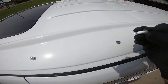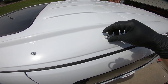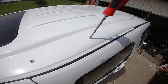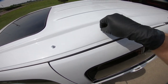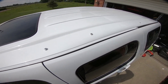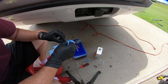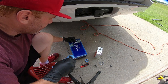As you can see I already ran one down. Once you get the Teflon tape on it, all you do is screw it into place. Make sure you have the plastic collar on before you put the Teflon tape on — it will probably slide over once it's in place, but better safe than sorry. Just run these down until they stop — we have to do this 10 times. I'm not going to use my impact for this because I want to make sure we don't strip anything out. Once it's in place, all we need to do is grab our newly painted cap and pop it on. Before priming the caps, I wiped each one down with some 3M general purpose adhesive remover to get any oils, dirt, or excess sanding residue off before painting.